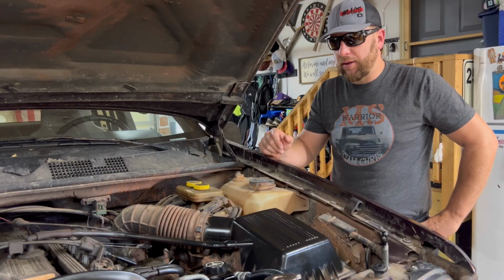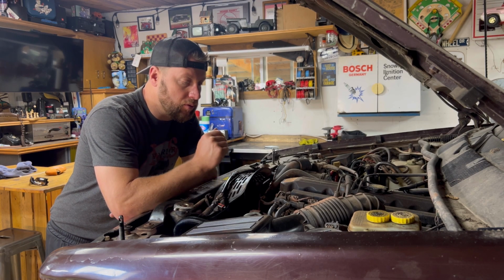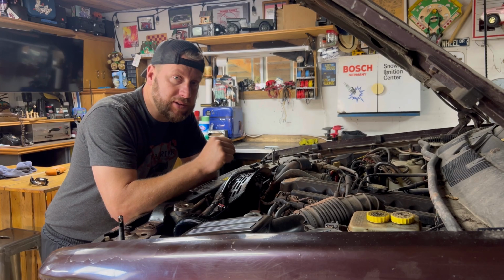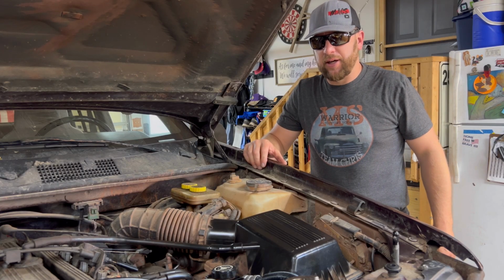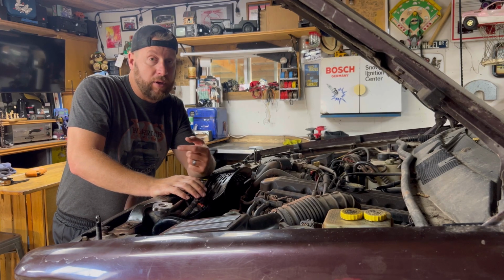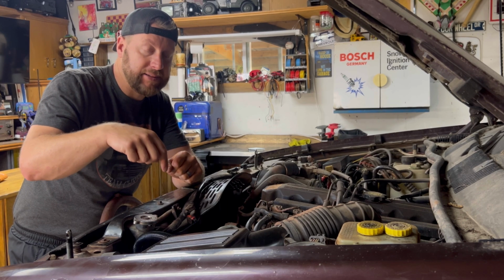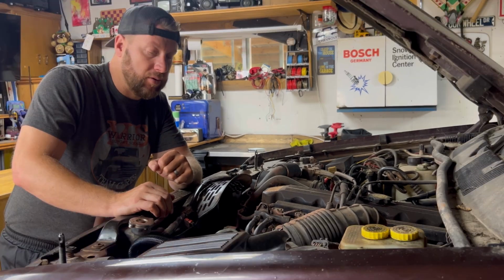So how are we gonna tell that this mod is a good upgrade for everyone else? Everyone's gonna have to check the next video where we take this Grand Cherokee out in the woods and thrash on some big rocks and some big hills to see if this power steering upgrade is worth your time and efforts to upgrade that pressure valve. That sounds like a good time. I'm gonna have to watch that next video to see how this mod performs out in the woods. Yeah, I think you and I are gonna be impressed by how much better this power steering is gonna feel. Just by replacing that pressure relief valve and gaining more capacity with power steering fluid while cooling it, I feel like this mod is gonna be pretty rad with those minor upgrades.